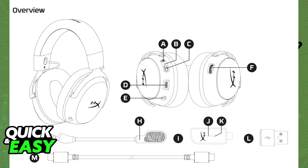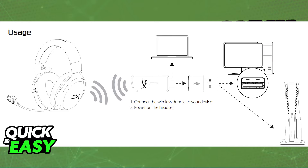If your headset is wireless, follow the specific pairing instructions provided in the user manual. Usually you will put your headset into pairing mode, then on your Windows PC go to Devices and then Add Device. Choose to add a Bluetooth device, and if your PC has a Bluetooth adapter or card, you will be able to get it connected.